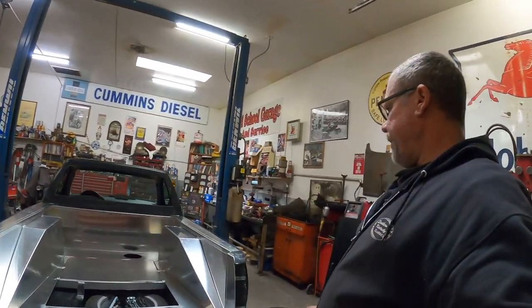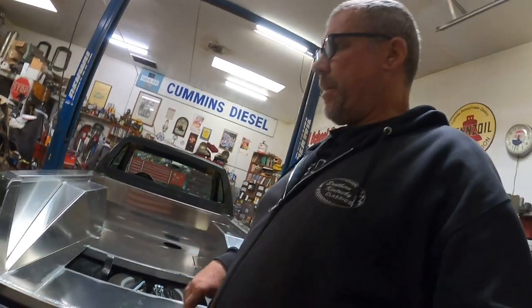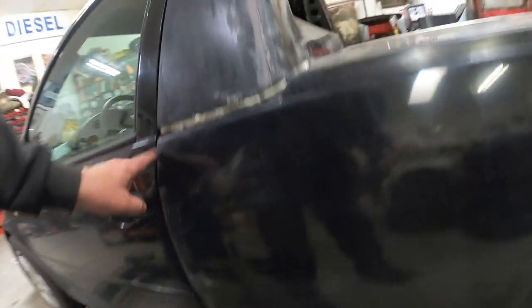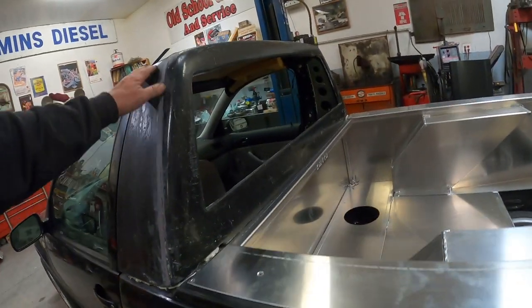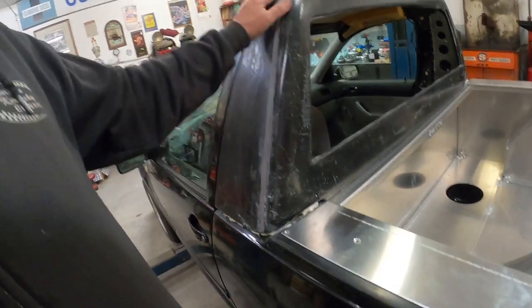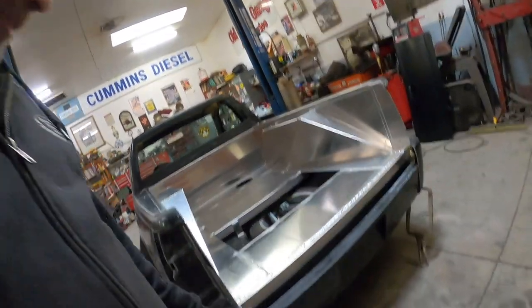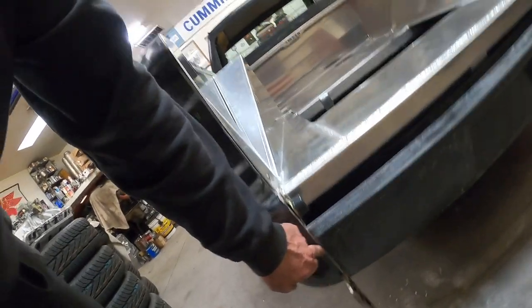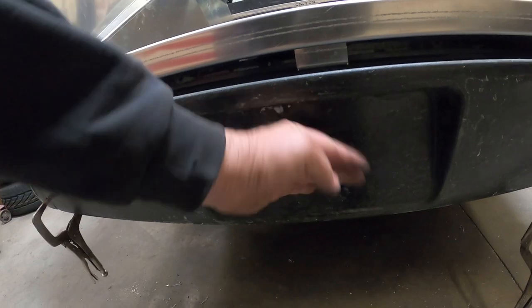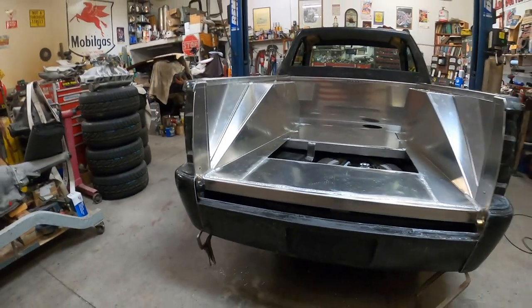That went a lot better than I thought it would. You saw the time lapse on this one. This panel has three screws in the top and flush rivets along here, and it looks really nice with that piece I cut off — fits really good, just a little body work to do there. I put expanding foam in the top and I've got it all glued and screwed and ready to go. What they want you to do is use windshield glue, but I might put cabosil or something like that, then kitty hair bondo across there. All I've got left is the tail lights and I've still got to finish fitting this panel — I've got to trim some off here. Before I get too carried away, I'm going to put a receiver right here with a fold-down license plate, and I'll be able to slide my receiver hitch in right where the license plate is.